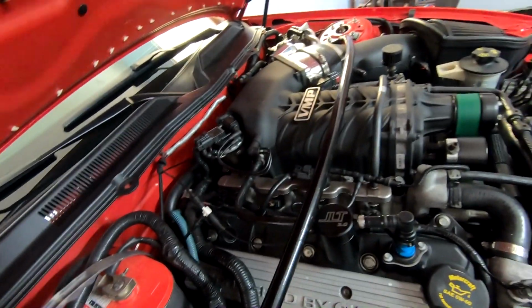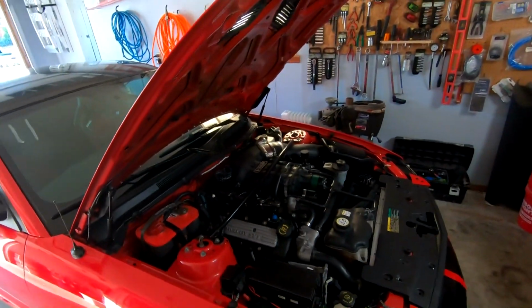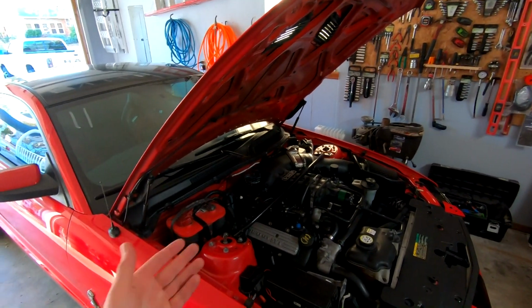And when it's trying to make all the boost, I'm wondering if it's sucking in some air that's already gone through the intercooler and now it's coming back up around and doing that circulative motion. So we're kind of recycling and also causing increased load and higher IATs. Just a thought, but we'll see what actually happens once I get this thing apart.